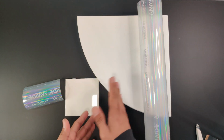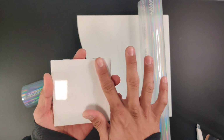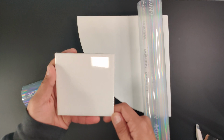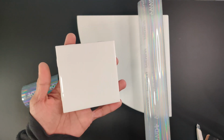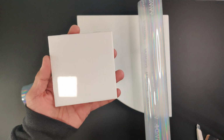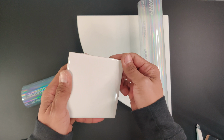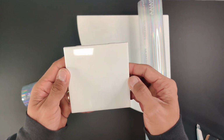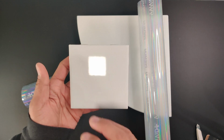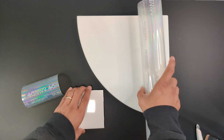And I have two surfaces here. This is just a glazed ceramic tile. It's a super smooth glossy surface, like what you would have on new automotive paint. It's a high surface energy. It's really smooth and really glossy, so vinyl adhesives tend to stick to it really well and grab onto it really nicely. One of the things with low tack is how hard it grabs onto a high surface energy substrate like this, which would be similar to glossy automotive paint.